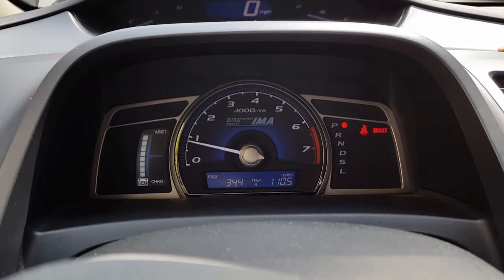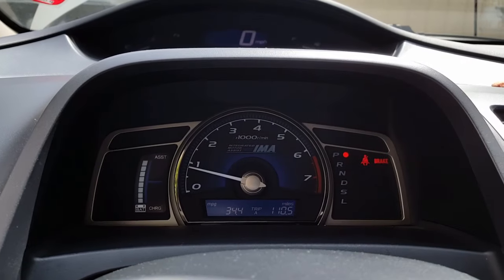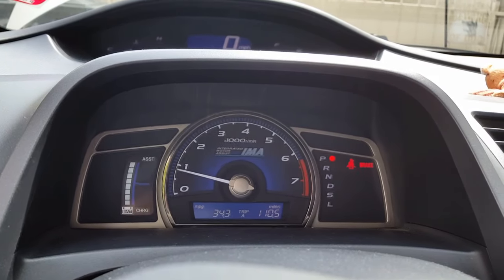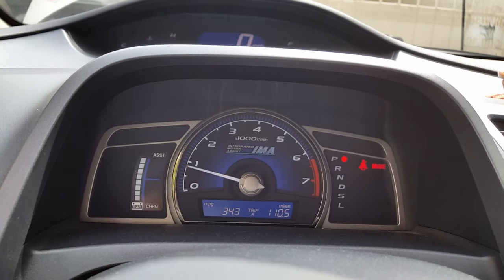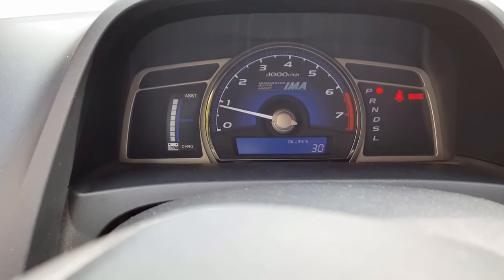So let's just wait five minutes — I'll probably just pause this video and wait. It's only four minutes in. It's been holding at 800 or so RPM, and that's right — normally the idle with no load is about 800 to 820, plus or minus 50. It's hitting 800 RPM on this car. I love this little car because I think it's very easy to maintain.